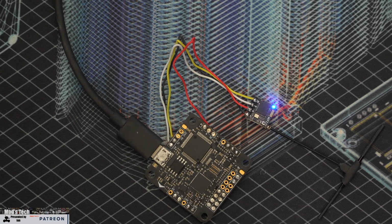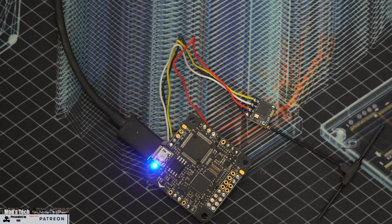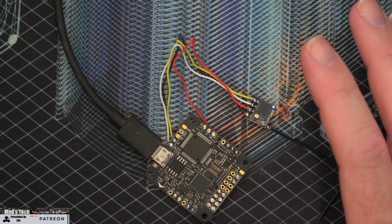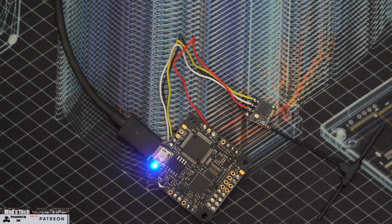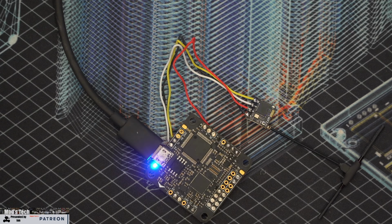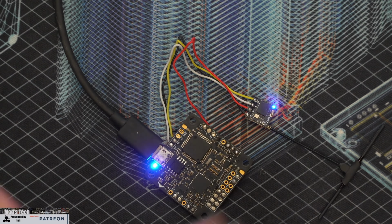So we're going to leave it. And again, if we go back, you can see we've come back now to the LED flashing. Now, a piece of advice I'm going to give is give this some time before rushing to close the window on your computer or knowing that it's finished or power it down. Just leave it. Don't rush to power it down, just in case it's still doing some of that firmware installation or booting process. Whilst it has come up, as I said, showing rebooting update success, just give it a minute or so, just so you're 100% happy it has done what it's meant to do.